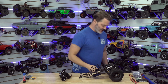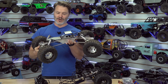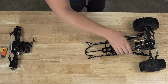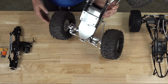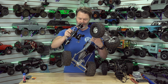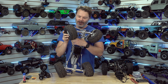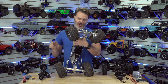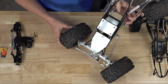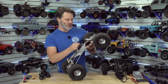So we've got this new in package, and then I actually bought this other one, which is essentially new in package. There's a couple of scratches on it, but this one is essentially what the old Supers would look like. I'll get this out of the way here. And this is built on X-Factor axles. As you can see, it's MOA, motor on axle on both sides, just like the old Clodbuster axles here. These were supposedly a lot stouter, but you break the shafts on them all the time. I forget exactly why they sucked, but I do know that they didn't stick around, which is really what matters. But this is the size and the heft of the old superclass crawlers.